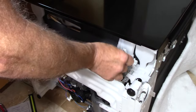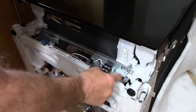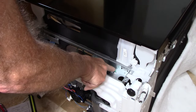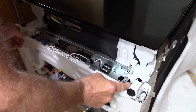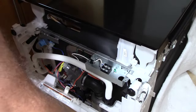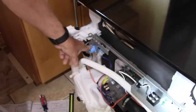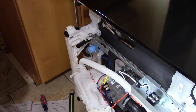We're going to slide our wiring through here and connect up the white, the black, and the ground - we'll do that once the dishwasher is installed. We take off this cover and slide it right out. Now we can connect our supply line going into the unit itself. We take our supply line - we've screwed the end on temporarily - and route everything to the back of the machine, then screw it on by hand.